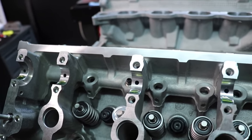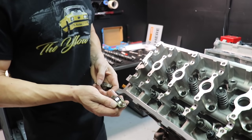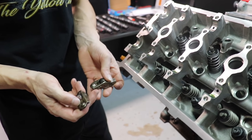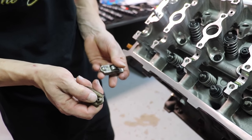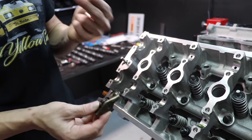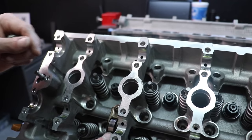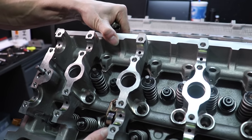We'll put it in a little bit low, put the cams in, put the followers on, and then put some preload in it. GT500 followers are going to have the same geometry as a standard four-six follower, which is what you'll have to use because there's no way to adjust it once the camshafts are in. These are factory four-valve ones — we've enlarged the oil hole slightly so you can get your tool in there and bring them up or down to set the correct preload.